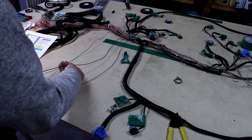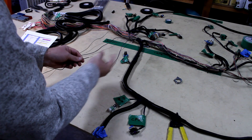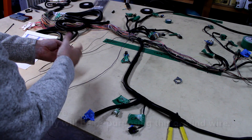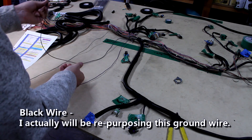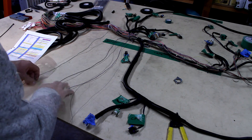This black wire I was not expecting, but it's not that uncommon. I tested it — went ahead and trimmed off the end and tested it on a ground connection. This is just a standard ground wire that grounded something, probably in one of those C100 or C152 blocks. So this is just an extra ground wire that's no longer being used. I'm going to go up to the junction point and cut it off — no big deal.